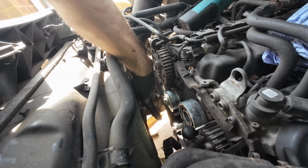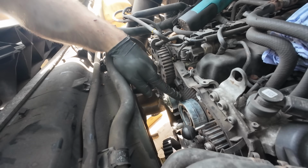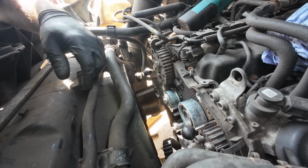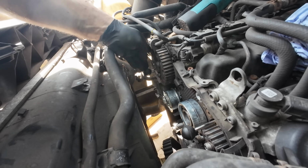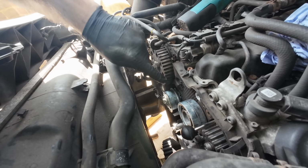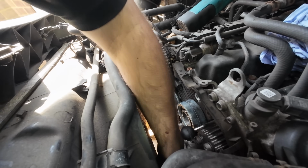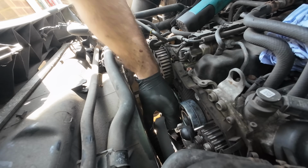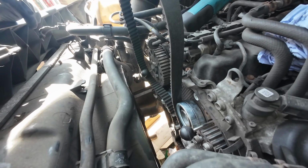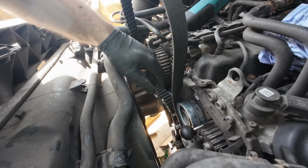That's that pulley on. I've got this pulley down the bottom, I don't know if you can see, and I always deliberately leave this one off. Just makes it a little bit easier getting the belt on. These pulleys are floating now. Just do them just off center, so when the tensioner pulls it round, it should pull it to the center. So let's get this belt on and routed. Wait a minute, we ain't got that bottom tool back in. Alright, that's better.